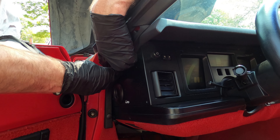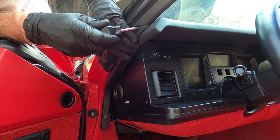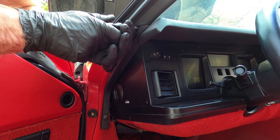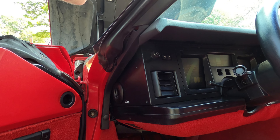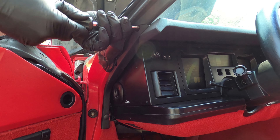I try to start with the middle first. I do not do the plastic push button first — I do that last, just in case I have to remove the weather stripping for any reason. I also find it easier to use a stubby screwdriver for starting the screws; I just have more control with my hand over the screwdriver and the screw. Once it's in, I'll use a longer screwdriver for more leverage. Again, push inward with pressure while you're tightening.